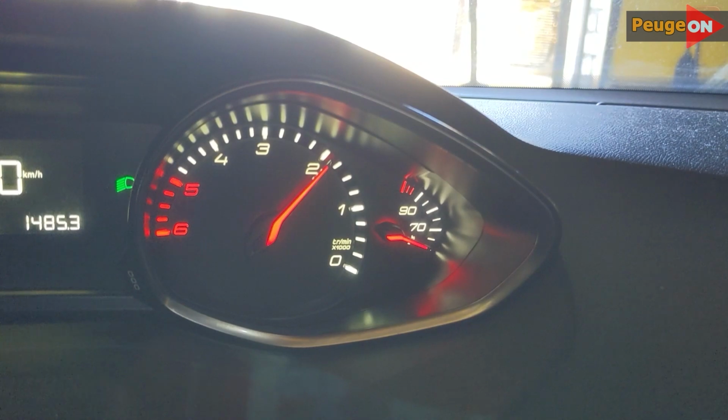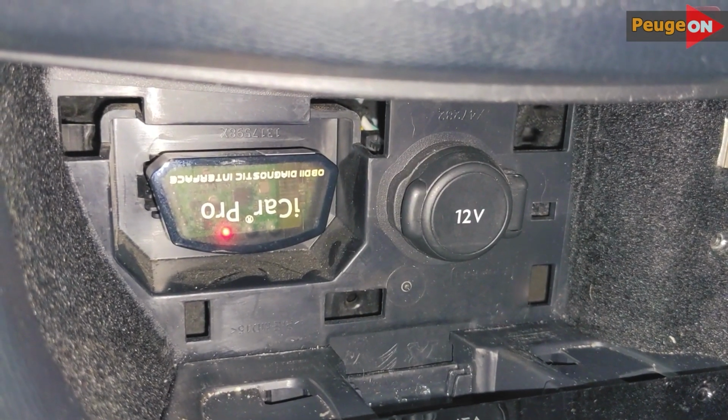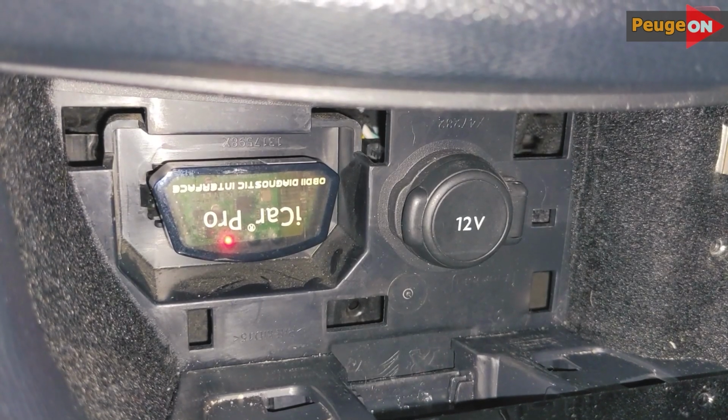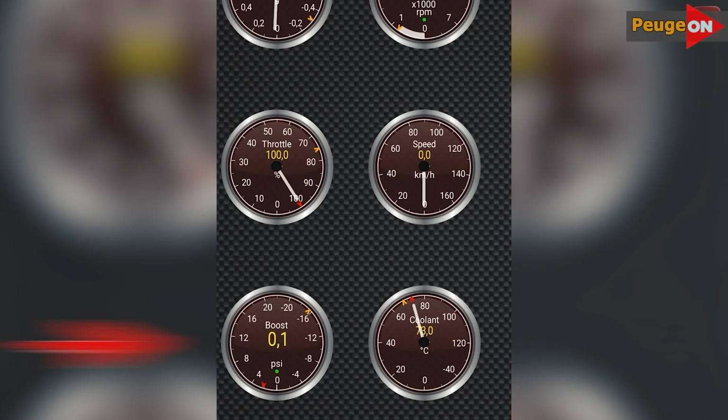To understand when this moment will occur, it's best to connect an ELM and check through the program. I use Fab. If anything, I'll leave a link to it in the description. It works quite quickly and more or less correctly. So, just like that. Once the temperature reaches 82 degrees, start timing 30 minutes. That's exactly how long your engine will idle and essentially be flushed.